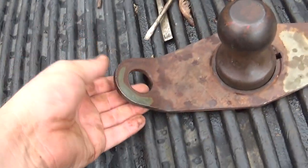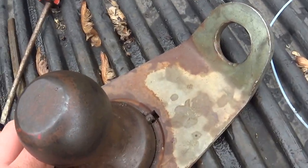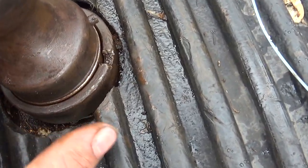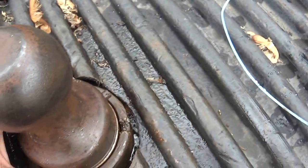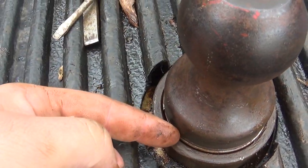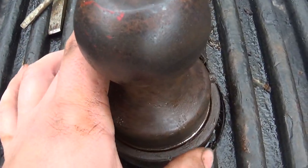To take your piece for the safety chains off, you take it to this notch here and that will lift out. Then this bottom piece here — I ended up having to take this snap ring out. I took it around to where I could get on it easy with the screwdriver and I was able to pop that off because I ended up having to take this whole piece off.